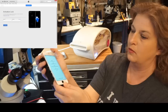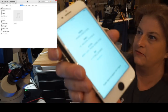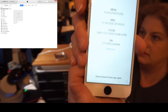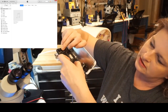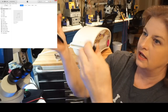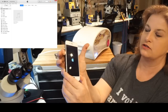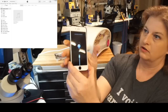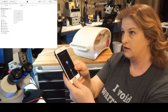We're going to disconnect so that we can boot it — here's the same phone. I'm going to lift up the battery and hold down the home button, then with our long cable prompt it to boot in recovery mode so that iTunes will let us restore. And we are now in recovery mode. I'm going to go ahead and put that screen back down again.